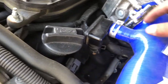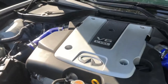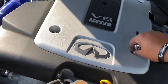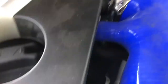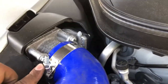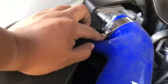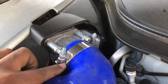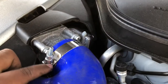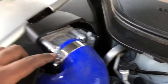When you put it on, you're going to have to put this on as well, and it's kind of hard to push up when you have the engine cover blocking you. Then you just throw your engine cover back on — make sure you still have all your bolts for that, it's 10 millimeters too. A good tip: leave your clamp bolts facing up, because if they're facing down it'll be a struggle to get to them. If you're at a weird angle, you won't be able to snake the wrench and socket onto the bolt, which could be another problem.